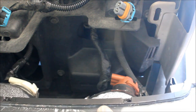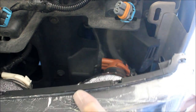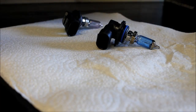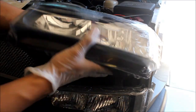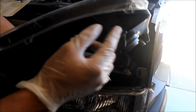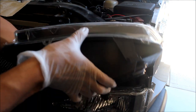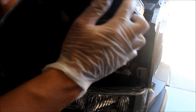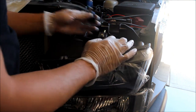Keep in mind, some of these aftermarket housings the fitting's not that great sometimes — this one fit good, but you might have to modify the plugs for the lights sometimes. While I was replacing the housings, I just have the bulbs over here on the bench on a piece of paper towel to minimize any contamination. These come manufactured with a silicone bead around them — I've also added a bead of clear silicone, usually used for bathrooms because it's waterproof and won't break down over time. So I've done a bead all the way around to help give us a better seal.